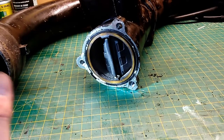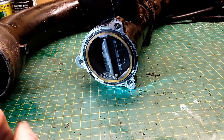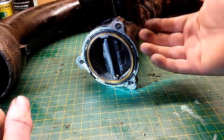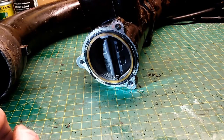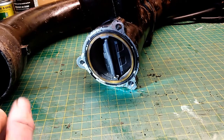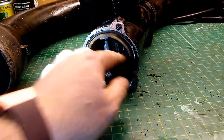As you can see, it allows the exhaust to get out because it's pretty pliable. But in the event that the rear end of your boat sank into the water too quickly and the currents were just right, there's a chance — actually a pretty mild chance — that water could come back up through the exhaust, back around the Y adapter and into your engine. The factory put them in for that reason, so it's a good idea to keep them on there as insurance.